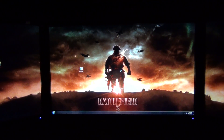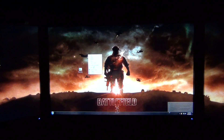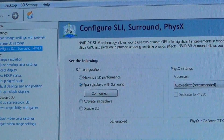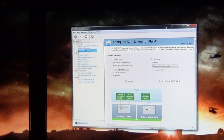The issue I had: it took me about an hour trying to figure out why one card was always staying downclocked — one was going up to around 900MHz, the other was stuck at 600 and never went higher. That's because once you BIOS flash your cards with SLI enabled, you're going to have to go to the NVIDIA control panel, go to SLI settings, and reconfigure them — or disable SLI then re-enable it so your cards run at full speed. When my computer booted, it said 'SLI settings have been reconfigured, please configure them,' so I had to re-enable SLI.